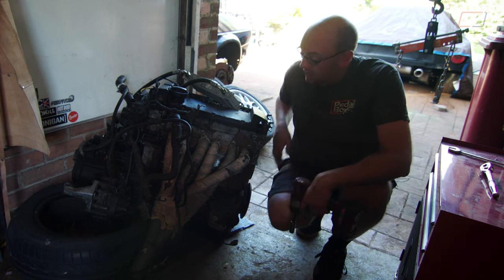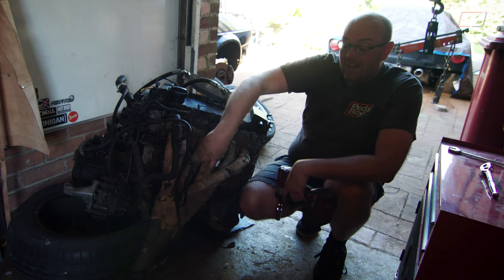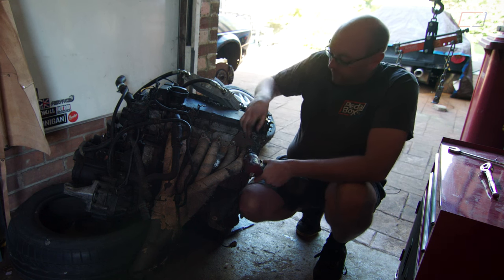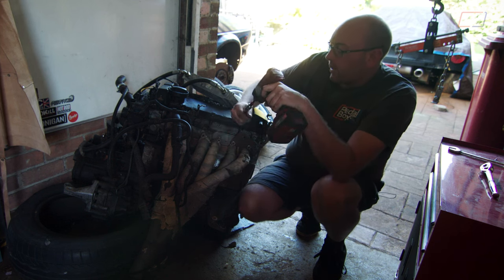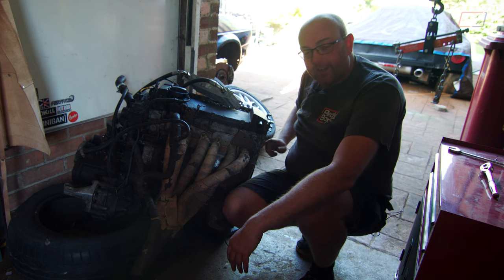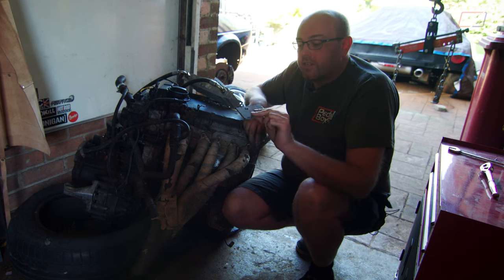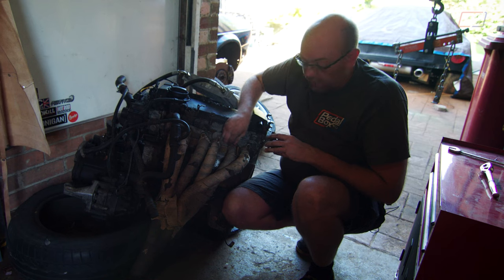We just dropped the engine here on a tyre and some mats overnight. Now I'm going to start pulling bits off, starting with the exhaust. Having it on the back makes it a real pain to spin the engine around in what is a fairly small garage. I've already taken all the bottom studs off — all the nuts came loose except one, which pulled the stud with it, and that is apparently a known issue. We also fabricated up this piece of quarter inch plate as a lifting point, with an 8mm hole, a 10mm hole for adjustability, and a 12mm on top.